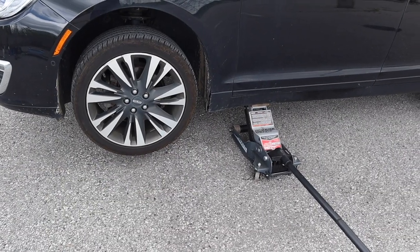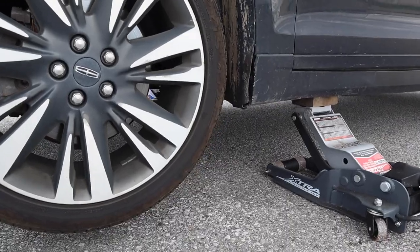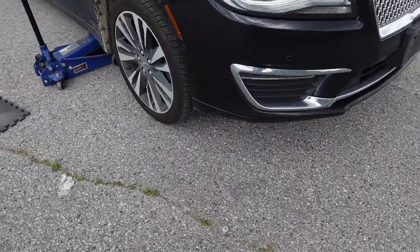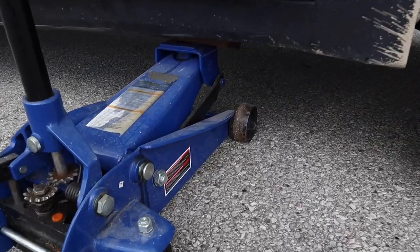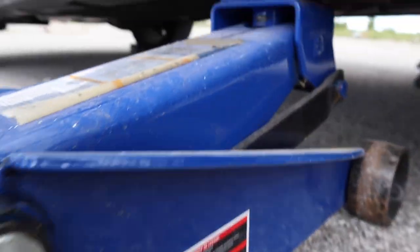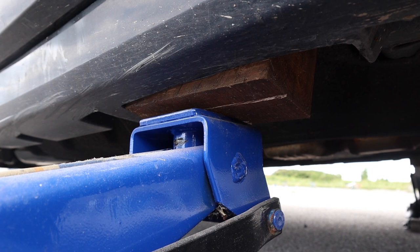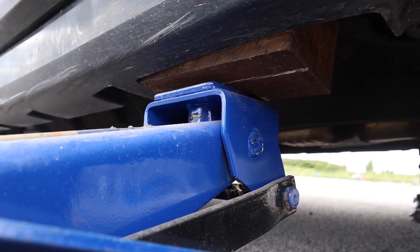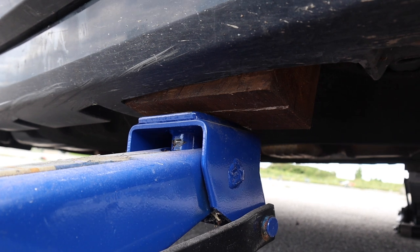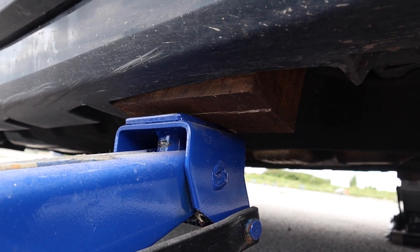All right, guys, I don't want you to mess up, so I'm gonna show you where I'm messing up. There's no damage done to the car, but you see the block on this side? It's nice and minty on its position stand. When I tell you gradients of sketchy parking lots or even your driveway are sometimes not ideal, I want you to look at this, okay? It's gonna have to do with the piece of wood, but hopefully the lighting can focus on this angle maybe. Okay, you can kind of see it there. So it's inside the skirt, it hasn't damaged anything, but the crack on that piece of wood, or even just the gradient of the parking lot, is not ideal, okay? That is not resting. You see how I put my fingers in there? Don't ever do that, but I'm just doing it to show you that while it is stable, just the slightest bit of a tilt in the ground will mess you up.